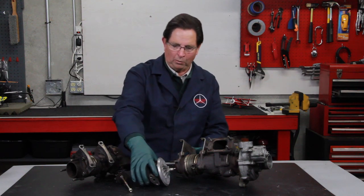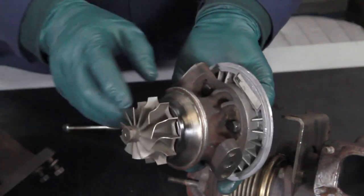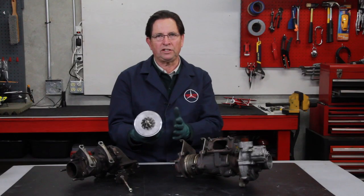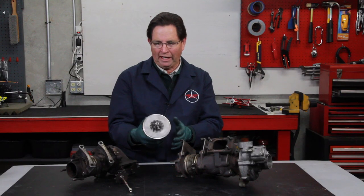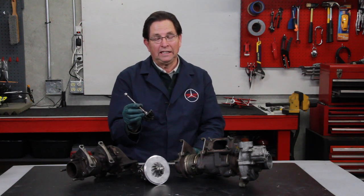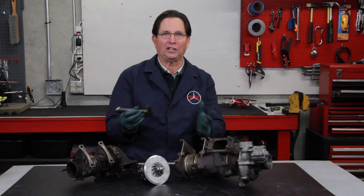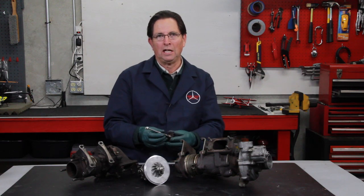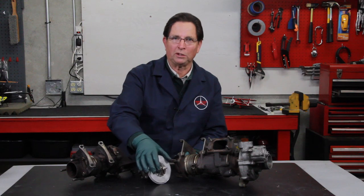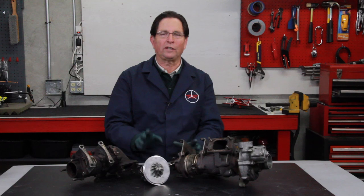The first thing we learned from taking apart one turbo was that the guts — all the inside parts, the sealing rings, the bearings, the thrust washers — they're all the same. This is a T3 turbo but it is modified. They do have a different turbine wheel and shaft; it's a little bit smaller diameter, which is kind of surprising. You'd think with a six cylinder engine you'd have a bigger diameter turbine wheel, but not so on this engine. Also there's a slight modification of the compressor wheel over the 617 engine, so it's going to be a little tricky to try to find those parts.